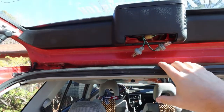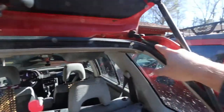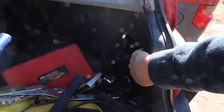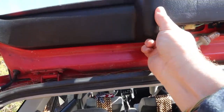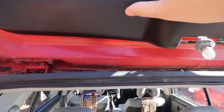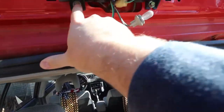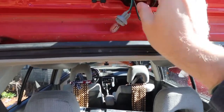The challenge will be running the reverse and the turn signals, but I can still route that up. I'm not sure if I'll be able to route it through this loom, but I'd like to do that. I think I could probably drop the cable down and feed it out. I hate these old plastic pop clips on these things — they make me nervous, they're gonna break. But this one's pretty good, actually in good shape. Thank goodness. I'll grab a 10-mil and pop this third brake light off and pull the wiring harness up out of the way.